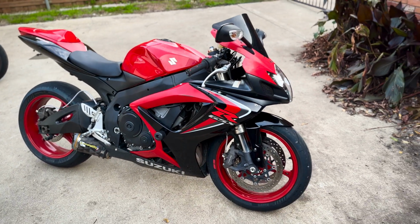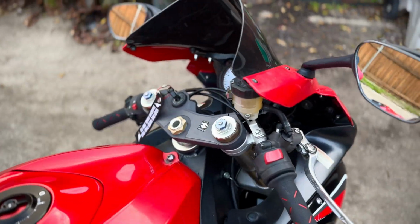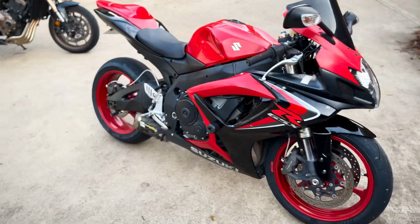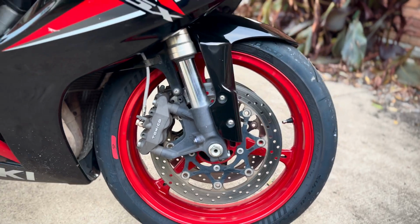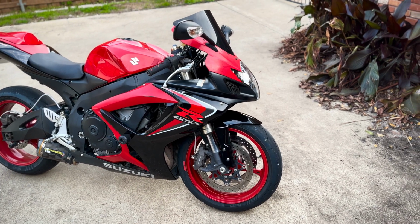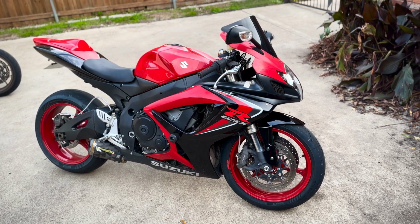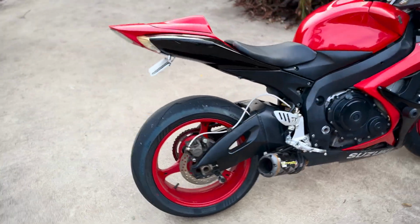Been reading the Suspension Bible and learning a ton, so enjoying that. But yeah, preload, got all that set up, messed with the rebound, so I've got that where I want it now. Jumps back very quickly, no oscillation, front and rear, so a lot better on that front. And then got compression set up last night too, so went with the stock specs and then added about a quarter or half rotation tighter, stiffer per se, so a little more aggressive, but since it's not going to see a track for a couple of months, figure not go overkill and just beat myself to death with that. So set that up front and rear, did high speed and low speed compression on the back,